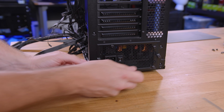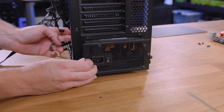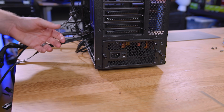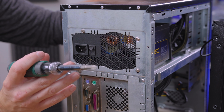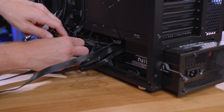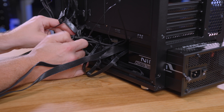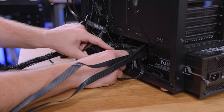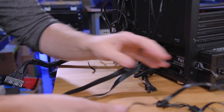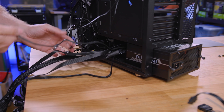This case is a little different when it comes to the power supply — it's got a plate that the power supply mounts to via four screws, and then the power supply slides out the rear. Your case may not have that; it may just have screws, which means the power supply has to come out from the side of the case. As I pull it here, you can see wires are getting hung up on things all over the place — so don't just yank on it. You could break things, especially if you plan on reusing the case. I'm just going to undo this bit of spaghetti so I can see what the wires are getting hooked on — like an RGB controller here, a SATA cable there. Our 24-pin was what was getting caught up.